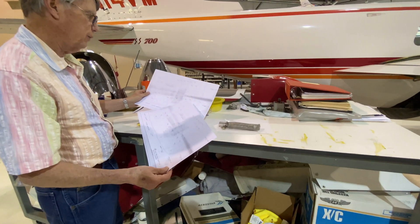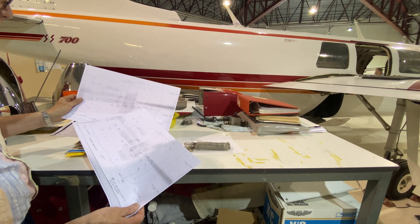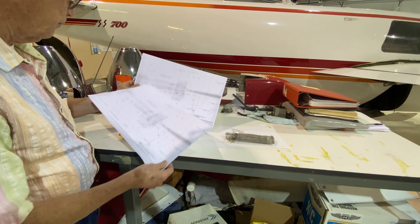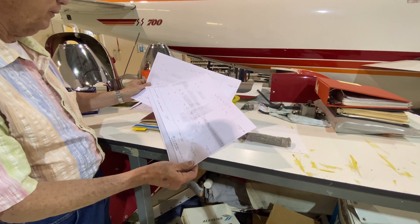So you're always going to be required to put some structure in there to account for the hole you cut. And look at all those rivets — 1, 2, 3, 4, 5, 6, 7, 8, 9, 10, 11, 12, 13 on that side. A double row of rivets here and single row rivets there, and these rivets tie into the spar cap.